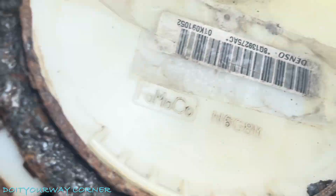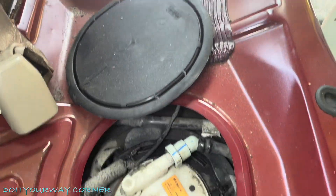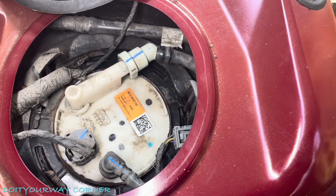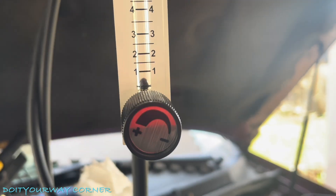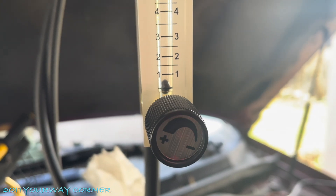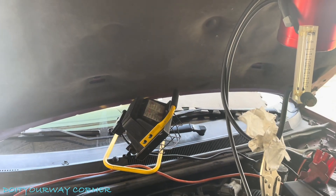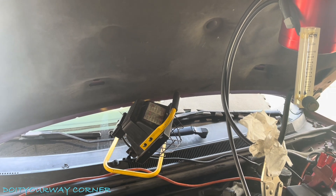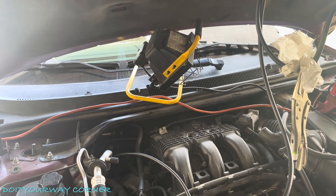So I'm going to put the seat back in and go underneath the car to see if I can hear anything. What's interesting is I've held this thing under pressure the entire time and my flow gauge stayed at zero — and this is with no compressed air going in. So it's holding. I don't know if the fuel when we fill it up is going through the canister in the back and saturating the foam that's inside of there. That's my guess, but I'm going to go see if I can hear some things back there.